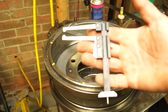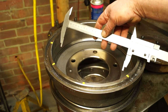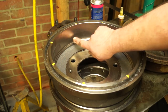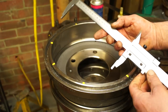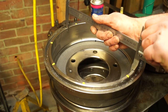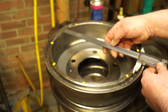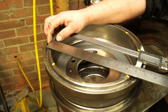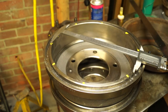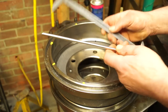I have a new brake drum here. This disc brake measuring tool for measuring thicknesses is absolutely no use. What you ideally need is a set of internal long-reach calipers specifically for measuring brake drum internals. You take four measurements, dividing the drum into eighths. With a new drum I can get an accurate measurement, and from that I made a rod — a piece of 6mm stainless steel bar cut to the right length. This is what we actually do in a workshop for measuring brake drum tolerances.